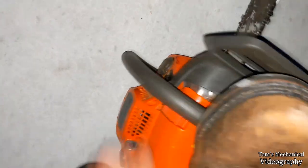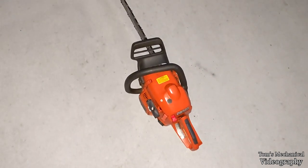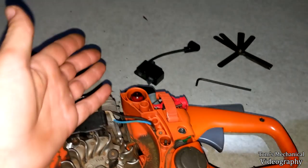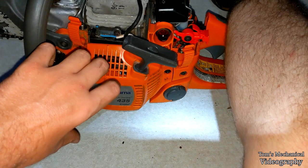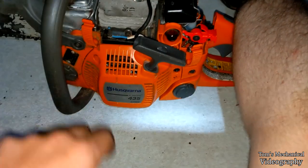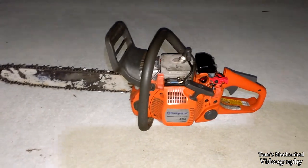Running rough — not a good sign. New coil out, old coil back in. She's running better now with the old coil. The recoil suddenly broke too — everything's just falling apart. That's fine now; I just had to get in there and give the Allen head on the back of the recoil starter one-eighth of a turn and the whole thing slurped on up, then I tightened it again. The chainsaw runs just fine now — revs up, no problem — with the old coil back on it. Confirmed: the Chinese coil is junk.